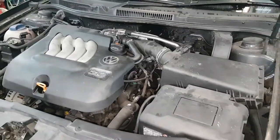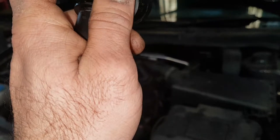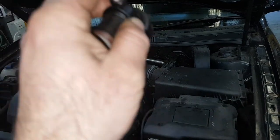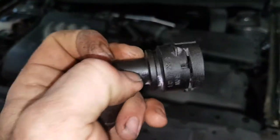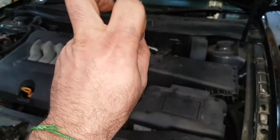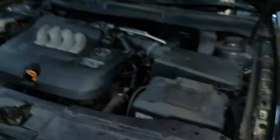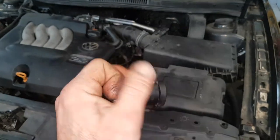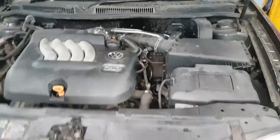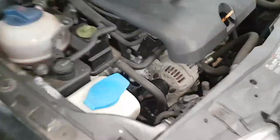You can use mirrors, you can use lights, you can remove all this to reduce the risk of damaging stuff — I'm not saying not to remove it, I just never needed to. Even though that clip looks like it's easy to get off, with that powder and stuff I couldn't get it off. I started using all different things, but a small thin screwdriver — not really a pick — you need that screwdriver to be able to pull it down. The quickest and safest way I always find is to pull it off on an angle: pull it down, then give it a flick left and pull the whole clip out. Otherwise it's going to keep jumping back in on you and you'll end up in real trouble.